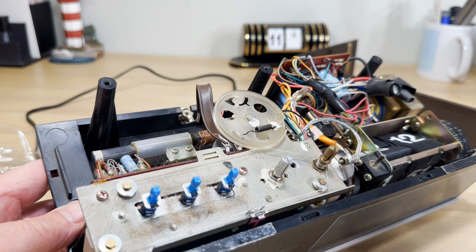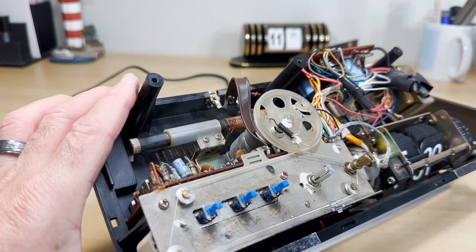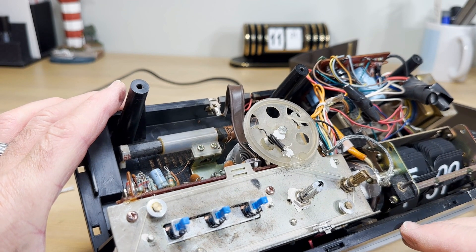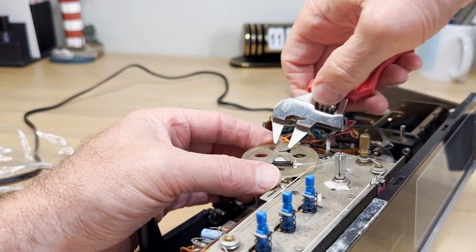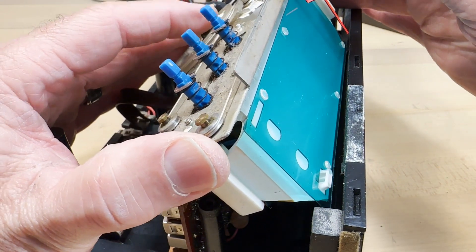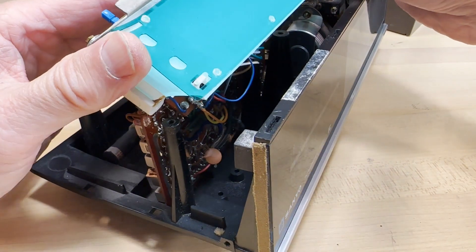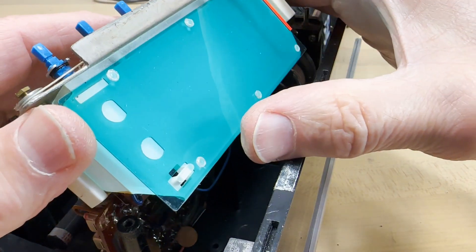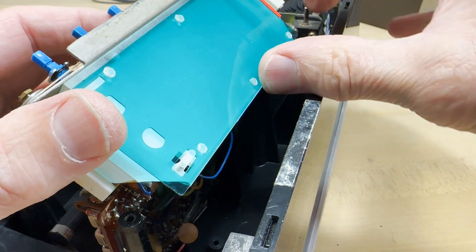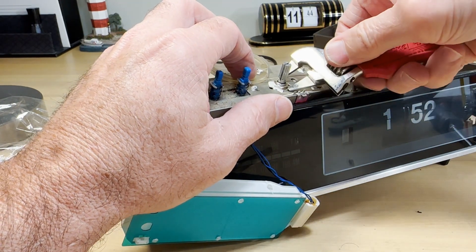After that you get into this — it's an older clock with a tuner that has a string, so I've got to get in there and get all this off to reach the potentiometer, which is the volume component. A lot of times people say their radio doesn't work — this is how to fix that. I take the nut off to get the tuner off, keeping the string in place as long as I can. The tuner background is lit by incandescent bulbs — we'll talk about how to find a replacement, since it's not a standard bulb and you have to figure out what voltage you need.